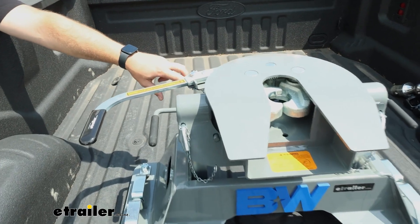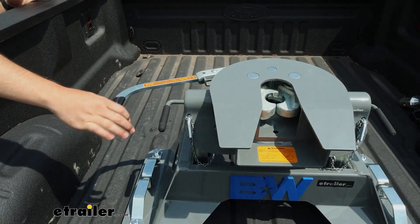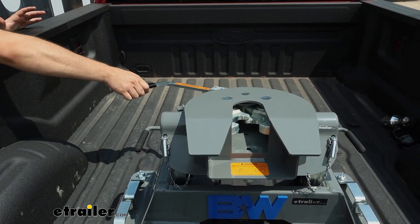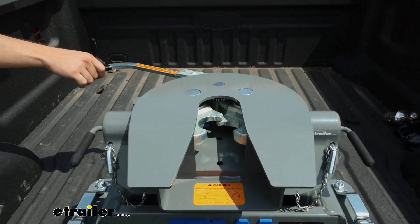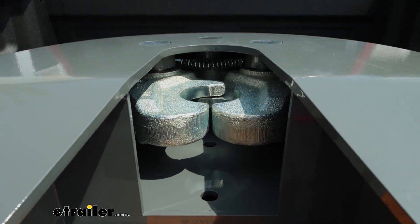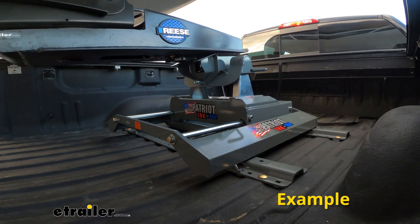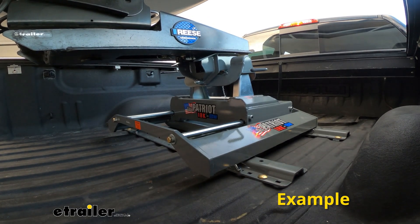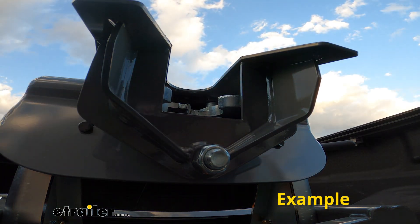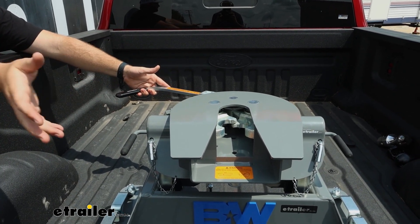The hard part is going to be reaching this pin. If you can get this pin unsnapped, you take it out, and then the fifth wheel will have this really long handle, which allows you to open it with ease. The jaws are spring-loaded to help you open and close it. When you back into the fifth wheel itself, these are going to slam shut, and then you can drop your pin back in place. When you're uncoupling, you open up this handle and it's going to spring open, which will spit your trailer out and allow you to pull away.